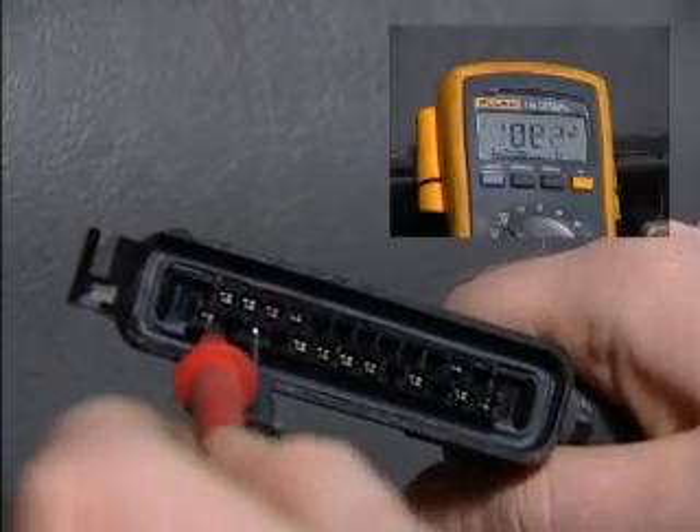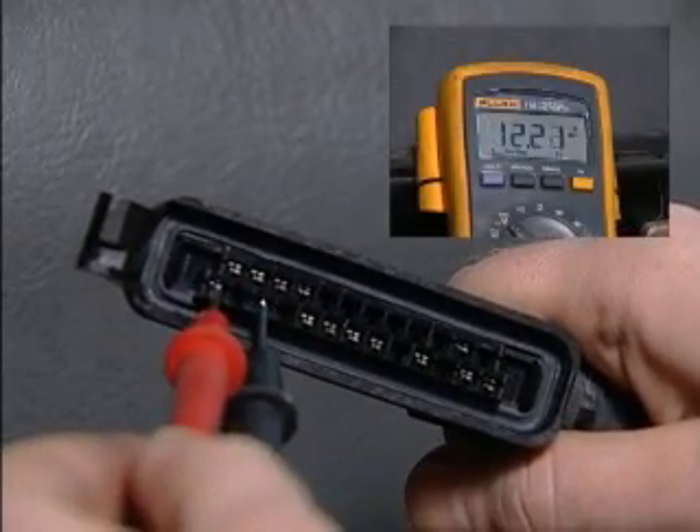The main power for the ABS interface is at pin 11 and pin 13. Pin 11 is battery ground, and pin 13 is ignition positive voltage, so we'll use these pins for our test. First, we verify that these leads have the correct voltage across them. The ignition will need to be on, but the vehicle does not have to be running. Here we see 12 volts.